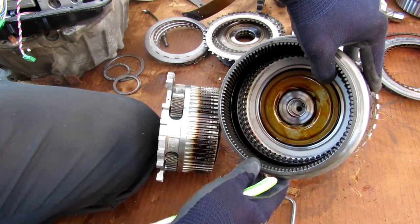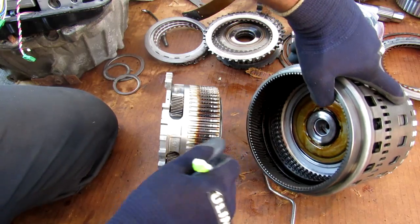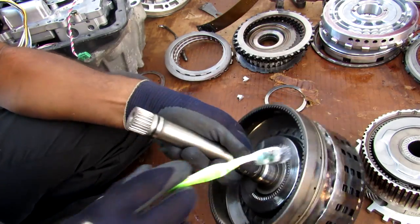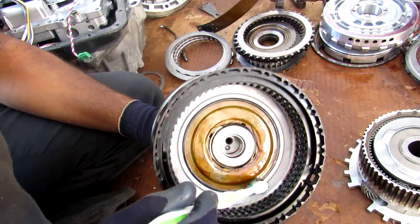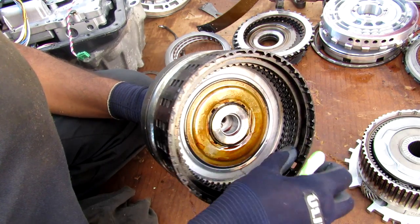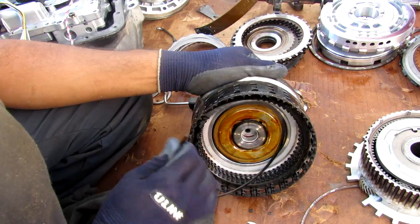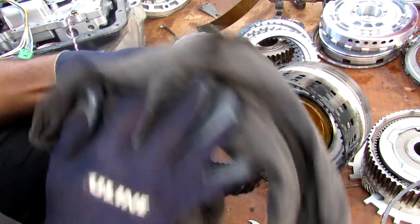Taking a look inside, you can see we have this clutch set and it's completely black — the blackness has gone onto the adjacent planet carrier that plugs into it. This clutch pack is completely burnt out and was one of the main issues causing the slipping. After removing this snap ring, we can take apart this planetary gear set for a closer look at that clutch. Here we've got the clutch pack and piston that controls the movement of this ring gear on the first planetary gear set. When transmission fluid flows through these small passages it fills up this piston creating pressure that closes these clutches together. Once they're locked together it locks the next planet carrier to the ring gear on the first planetary gear set. Removing this snap ring, these clutch plates come out — you can see just how black they are.